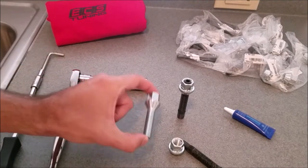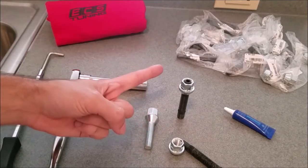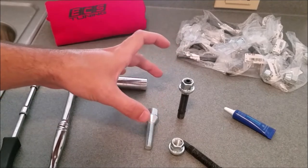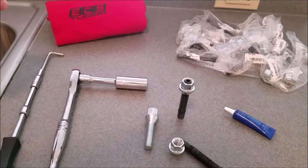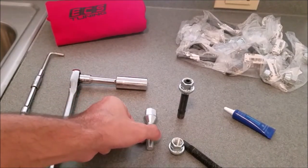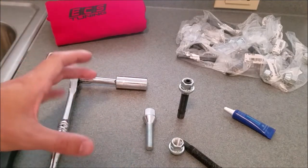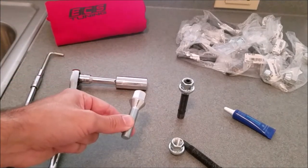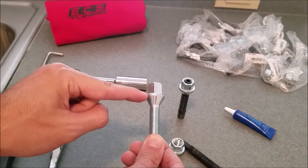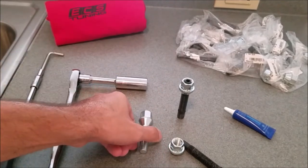I have no idea why the Germans like wheel bolts so much better than studs, but studs are a common upgrade for people who are changing their wheels a lot or who want the added strength and consistent clamping force that a stud offers. One problem I was having is I was having wheel bolts that were breaking. I broke two aftermarket wheel bolts and one factory wheel bolt before I even put the wheel spacers on. I think part of the problem is just an uneven clamping force — if one of these bolts is torqued a little bit weird, or you get some binding between the cone and the wheel and keep torquing it, you're just going to put a lot of extra stress on it and they're going to break.